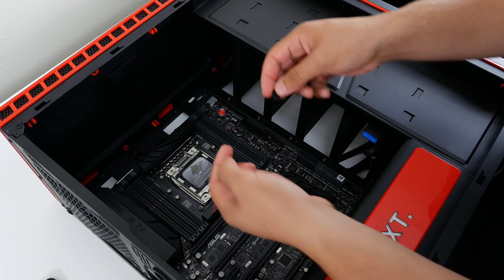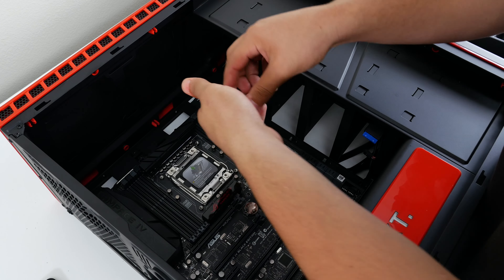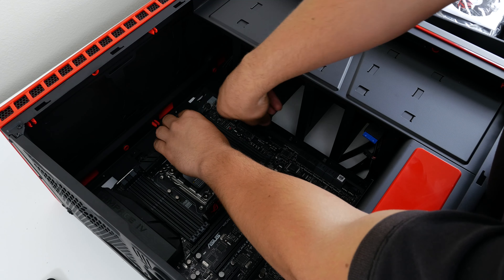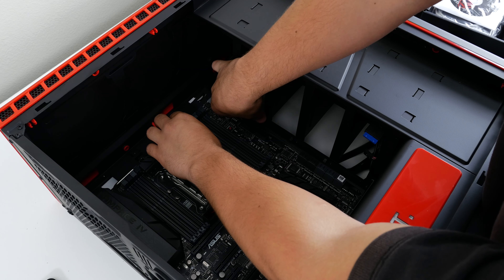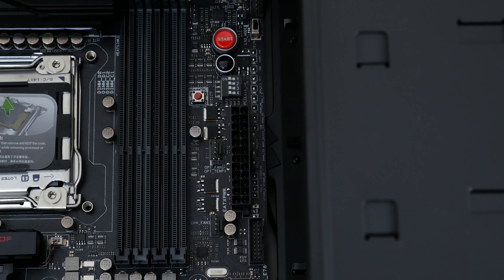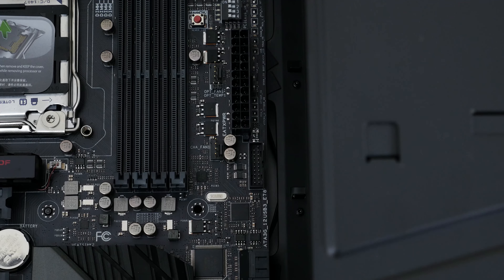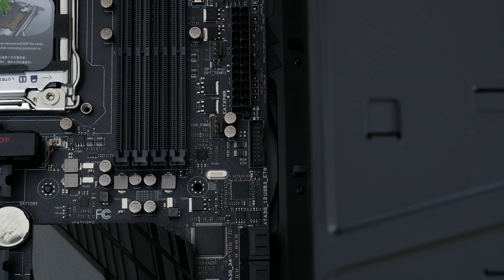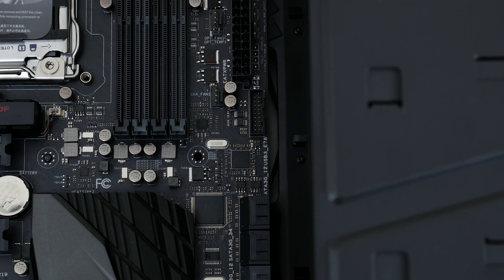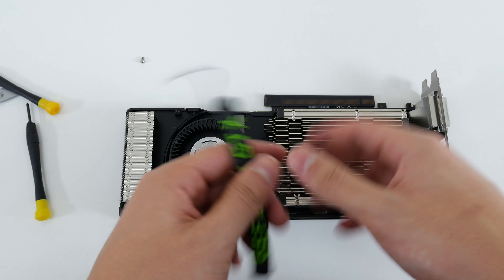This is the crucial part: the reason the motherboard is incompatible is because it's an extended ATX motherboard and the side of it touches the case, which is a bad thing. That's where the rubber grommets come in — slightly raising the motherboard. Go ahead and slide the rubber pieces so they are in between the motherboard and the case. There are three locations where you need to place the pieces, and you only need one rubber piece in each spot, though you can use two if you're extra cautious. After that, tighten the screws and that's basically it for fitting the motherboard into the H440.